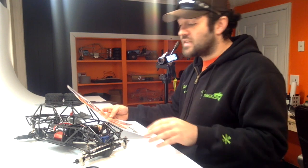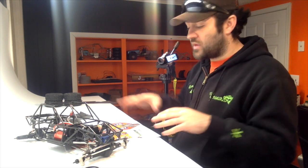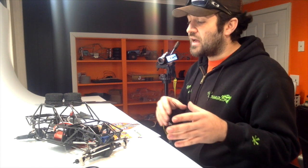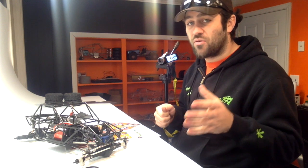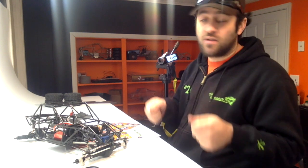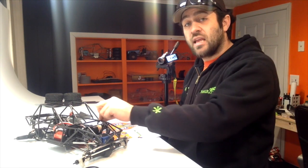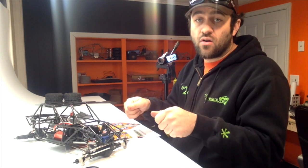Since this chassis is a custom chassis, it doesn't come with panels. I came up with the templates for these skins, and I was just going to use that same template to cut my aluminum panels. However, the fit just wasn't quite getting there. So I ended up going with my old method of creating panels — stretching blue painters masking tape over the entire chassis, pushing through the little nuts with an Allen driver to mark my holes, and then cutting the blue painters tape with a razor blade knife. Peel that off and apply it right onto my aluminum panel.